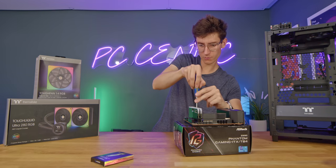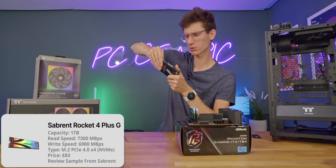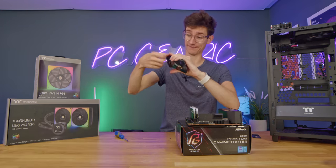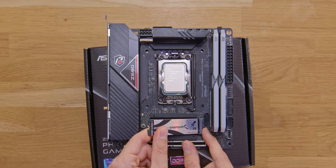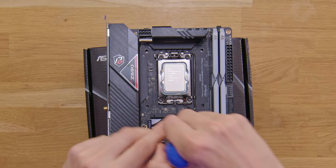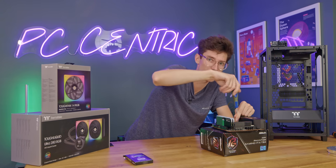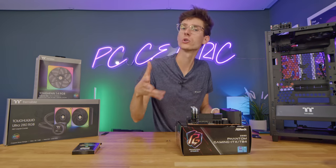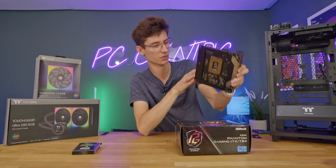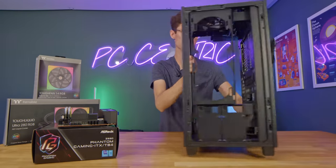The only thing I will say about the RAM is that it is a touch on the high side, so if you are using a lower profile CPU cooler, do be aware you might want to grab something lower profile. Once that's in, we're going to want to remove our SSD cover, then we can go ahead and pick up our SSD. This is a brand new one from Sabrent - it's a sequel to their Rocket 4 Plus, the gaming edition. Pretty much any fast Gen 4 drive should be absolutely fine, but this is going to be the sweet spot in terms of price and performance. The only thing I'd probably change is to make this a larger capacity, because the downside of ITX is you're also reduced in the number of SSDs you can support - I think this board is just two.